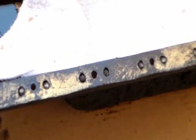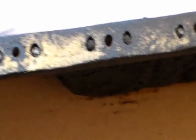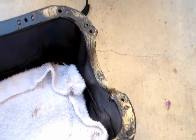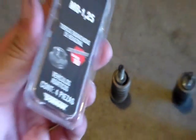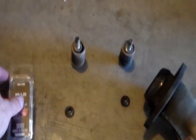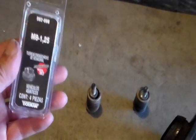Those things right there, it looked yellow. The reason it looked yellow is because I sprayed these on it. The nuts that got stripped, I went to AutoZone and got some new ones, so I'll be good with the nuts. You don't want to use just any nuts on that screw. You want a nut that's gonna be able to handle the heat from the exhaust pipe. So I got this at AutoZone, because with these nuts, there are some weak ones and some stronger ones.